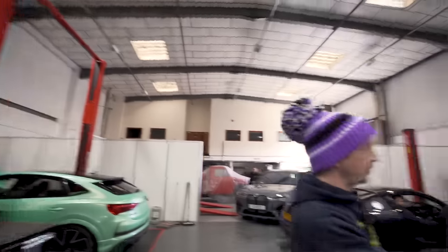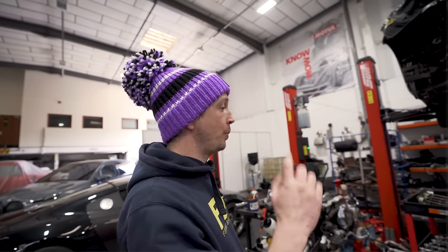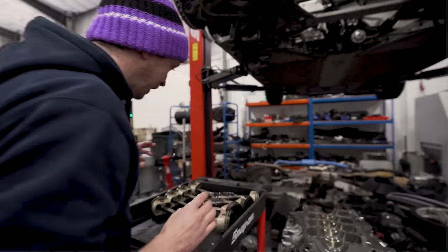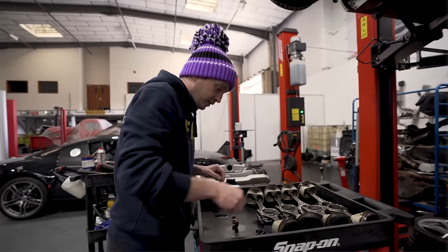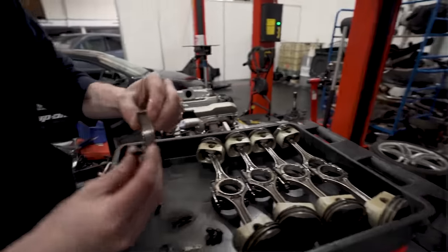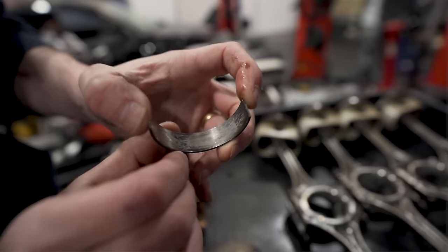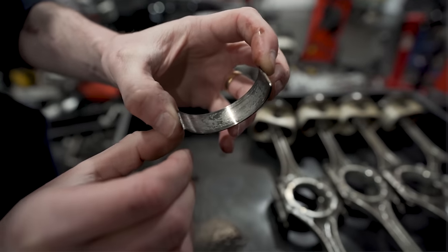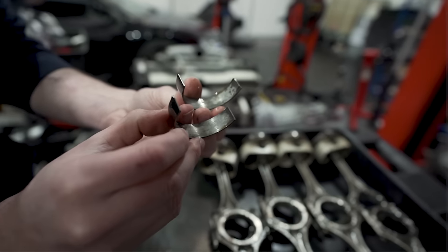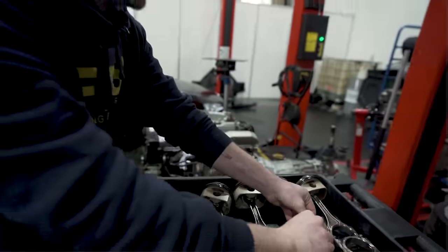While I've been off, Carl's made a mess. This is Adam's — the one that had rod knock. Carl pulled the engine, stripped it, and now he's got to start sorting everything out so we can reassemble it. I have genuinely never seen an R8 have bearings in such poor condition. Where the oil's oxidised — you can see where it's all started to take the top coating off. It looks like milky oil but it's actually taking the top layer off.